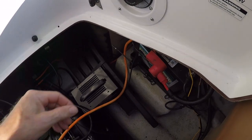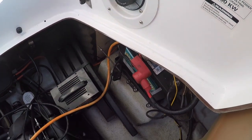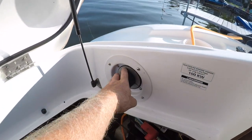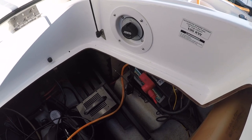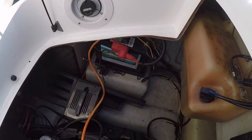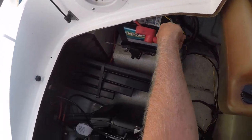And at the same time, I guess I gotta fix the battery hold down bracket that was made overseas and obviously didn't last. So I'm gonna pull the battery charger out of here because the battery was dead again. If I switch this off, it's fine, but if I forget to switch it off, within 2 weeks the battery's flat dead. So let me pull the battery charger out and then we'll hook up a meter on the battery here, amp meter, and see what's going on. And take off the ground side, I guess it's easiest to get at.